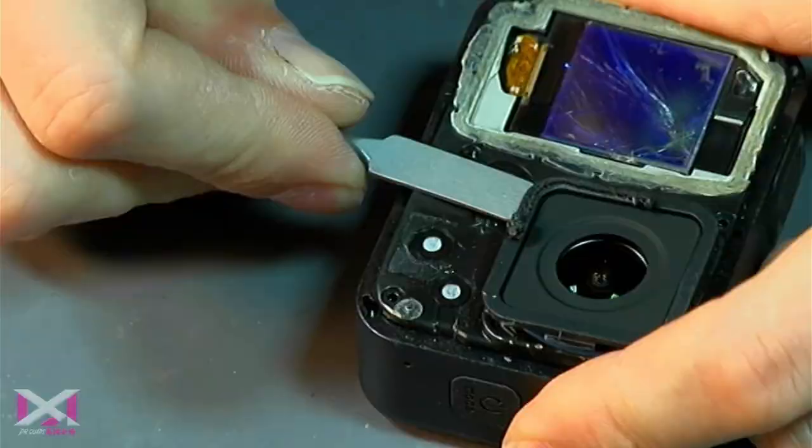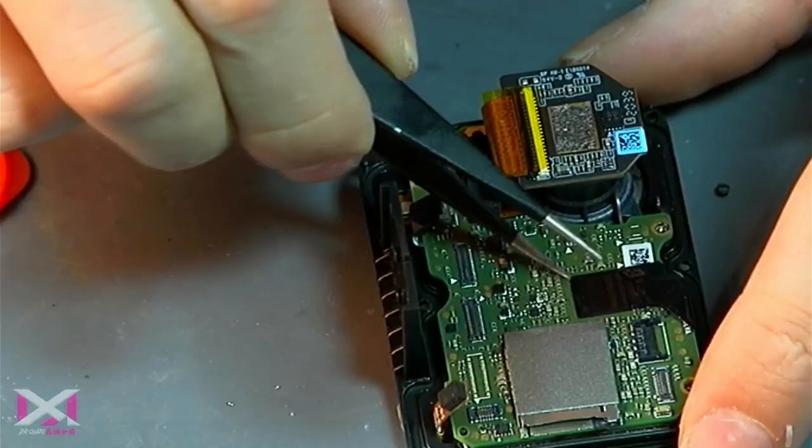One of the most common things to film FPV videos with is a GoPro. However, GoPros can be somewhere between 100 to 180 grams depending on which version you get, and especially the newer ones, which are only getting heavier. One way that really clever users discovered was to make the GoPro naked. And what that actually means is just ripping your GoPro apart and taking out all the parts that are essential for filming and throwing out the rest.